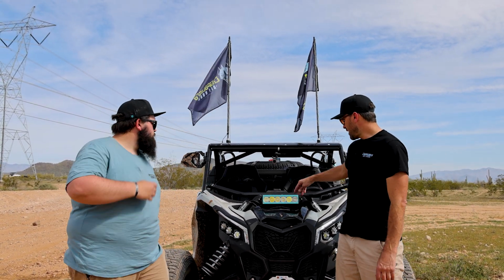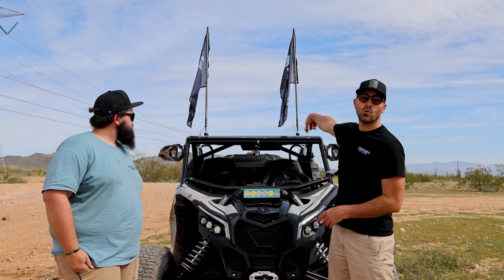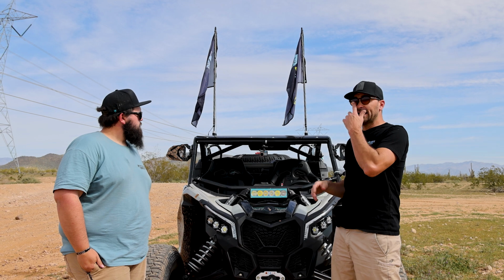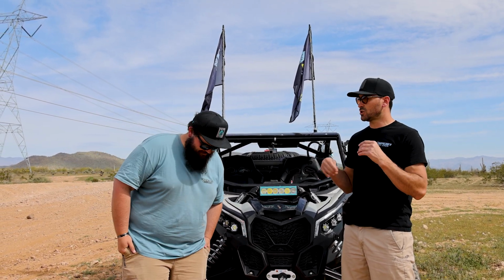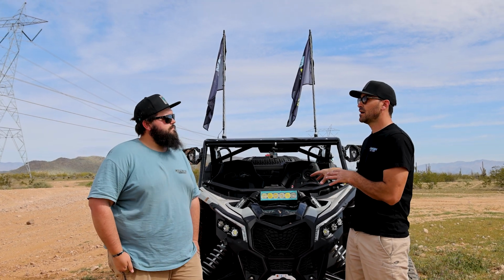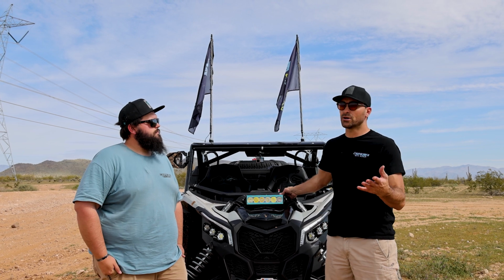What I mentioned, they have these completely wide open on your high and low speed compression on the front. They only had about 1 turn on the rear, so I like that. As long as we have this small bump sensitivity for slow all-day trail stuff with this setting, I'm gonna be happy as a clam, because I'm definitely gonna wanna crank this up when I go to the dunes.